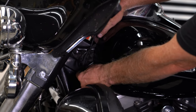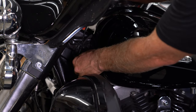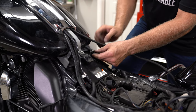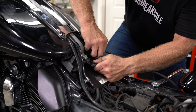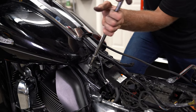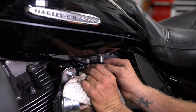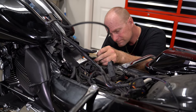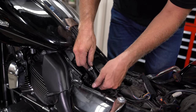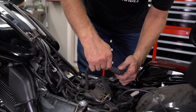He's just lining the front tank bolts up. The best thing to do is start both sides finger-tight and keep them loose, then start the rear bolts before you tighten anything down — that way it's easier to line the rest of the holes up. Getting both rear bolts on the tank lined up — this is why we didn't tighten the front down yet, gives you some room to wiggle. Got the other side finger started. Now go ahead and tighten the rear ones all the way down and then go up and tighten the front ones down. Don't forget to plug your fuel line back in — just pull up on the sleeve until it clicks and snaps. Don't forget to run your vent line — it literally just runs down the right side of your bike and dangles. Don't forget to reconnect anything else you unplugged — he's just snapping stuff back together, including the other vent line and the other plugs.